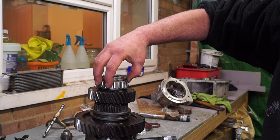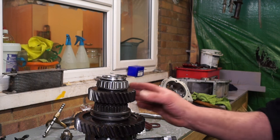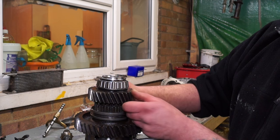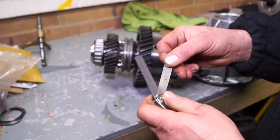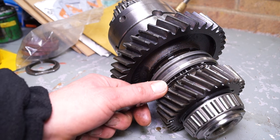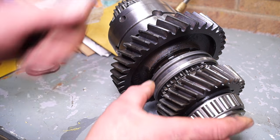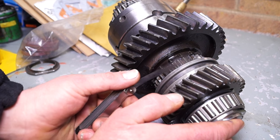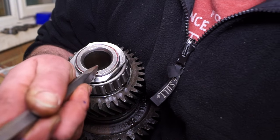Make sure you haven't damaged the bearing cage, that the bearing runs freely and there's nothing trapping anything. The gearing itself should turn fine. Do not stake this nut up at this point — because we've fitted new parts, we're going to check the clearance. Tolerance is between 0.05 and 0.15 of a millimeter. As it states in Land Rover, they show you to check this after you've assembled it, however I would advise to do it before, like I mentioned when stripping out, and after as well. I'm just making sure there is enough clearance — this is on the perfect tolerance of 0.05 of a millimeter.